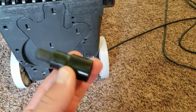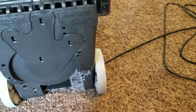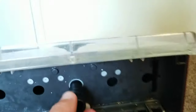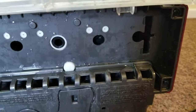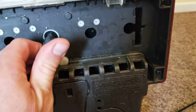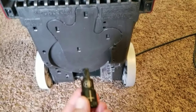All I had to do to break it loose was take a hex wrench — you can use an allen wrench or I have these socket adapter hex tools. I used a 9 millimeter, just plug it in there, then put a ratchet on the end. It barely took any force at all and it broke loose and started turning again. A 3/8 doesn't fit, so you're gonna need a 9 millimeter.